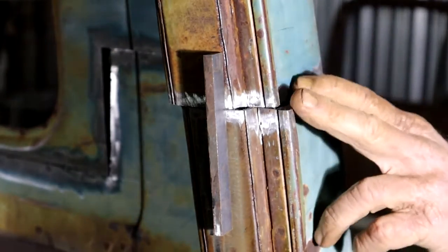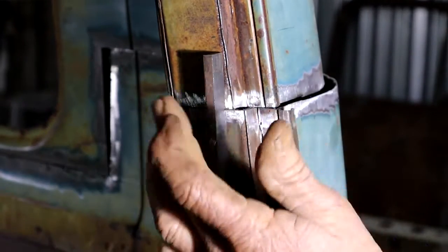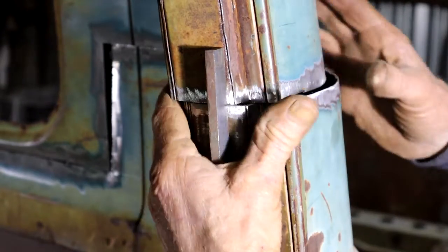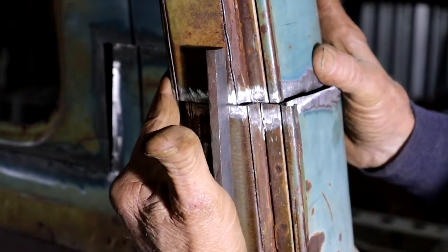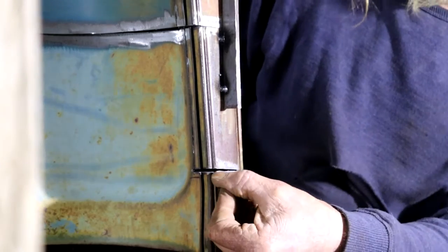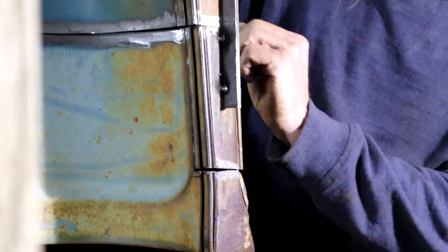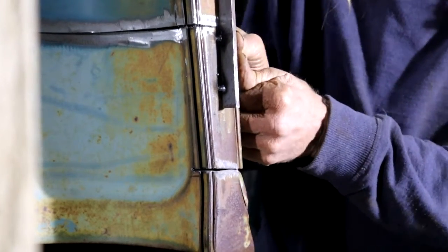Next I want to sort out this misalignment. So I first tacked on this piece of flat bar here, just to keep me lined up. It's only tacked on the bottom so the top can move — it's not attached. So next I made this cut here and I opened it up a little bit in a pie shape. And now look what can happen — this piece can now move in.